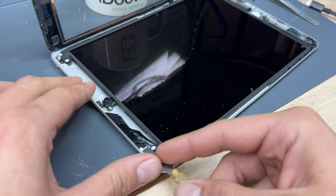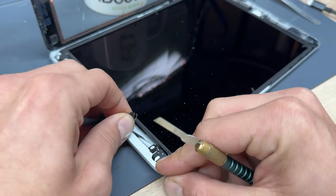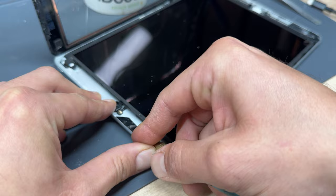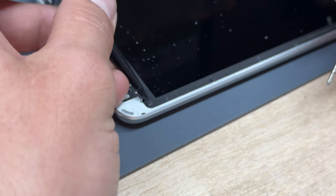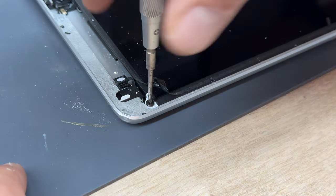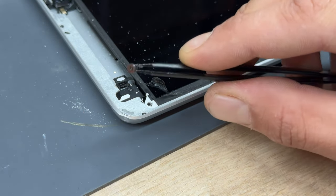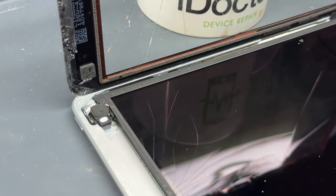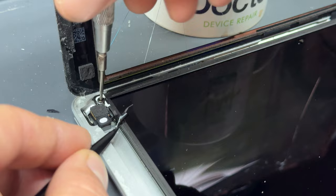You can see that some glass dust is going onto the LCD — that's not the end of the world. Dry stuff is fine; greasy fingerprints can be a pain to clean up, but I'll explain how to do that later. Now that the glass is removed from that area, we've got access to the screw, which is hidden under a little bit of black tape. Use tweezers to peel back the tape and then use the cross-head screwdriver to release the screw. Then work around the iPad, repeating the same step in each corner — carefully peel back the tape and release the screw.